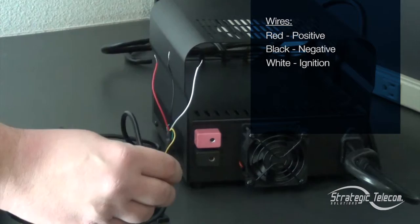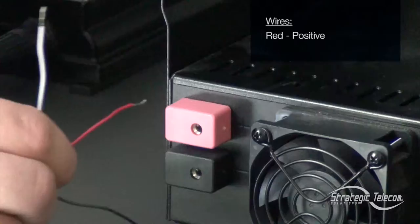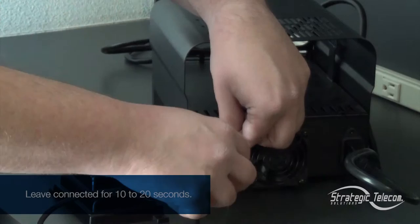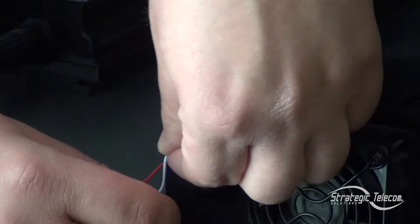What we're going to need to do is start by connecting this to a power source, like this battery I have here. Any power source that has an output between 6 and 24 volts is going to work. So we start by taking our red wire and connecting it to the positive terminal. Then we'll take our black wire and connect that to the negative terminal, and we're going to leave it like this for about 10, maybe 20 seconds. After that time has passed, you're going to go ahead and take your white ignition wire and connect that to the positive terminal along with the red.